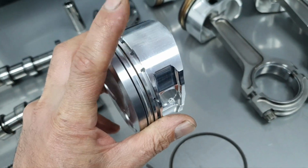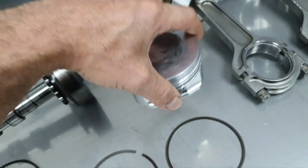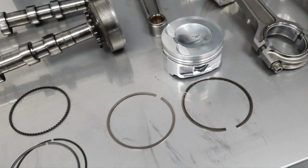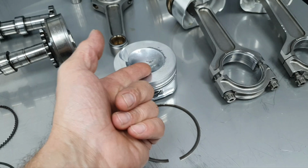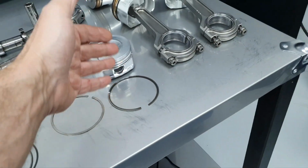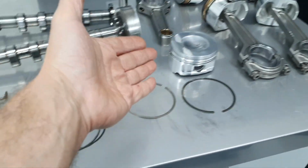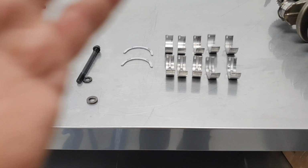You might have a piston slap, piston rattling on the cold start until you warm up and expand the piston. That means it's not ideal. Do not expect to make 100,000 kilometers with these pistons, all right? It's for different applications. I'm not saying that there is a problem with the pistons. I'm saying that it depends on the application, what piston you're going to choose. Lovely.